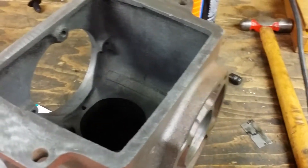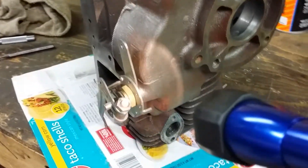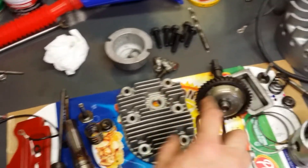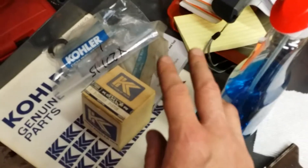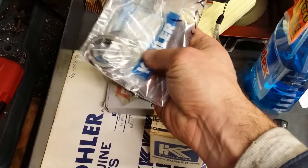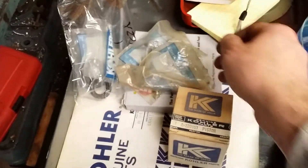Flipping the motor over to look inside — it's pretty clean inside, everything looks real good. The bearing surfaces are all good, the seal surfaces are good. I'm going to move forward on the motor. The head I had cleaned before and it's still good, so I'll just wipe that down. The camshaft's in real good shape. I scored a new piston for $15, and I have a 20-over ring set — we'll talk about that in a later video so I can size the rings to the bore.